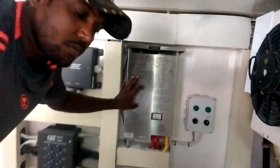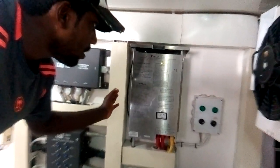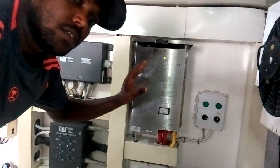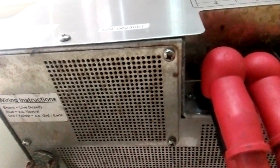Sometimes if you read the manual, it will tell you there's a small air filter underneath or on the side of the battery charger. I'll show you what kind of air filter it is — it's not a big one, you can see it has small holes. If this filter gets blocked by dust particles, airflow through the battery charger will be restricted and the charger will also overheat.